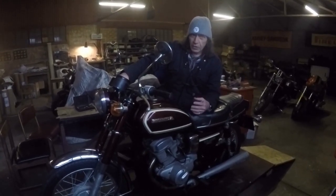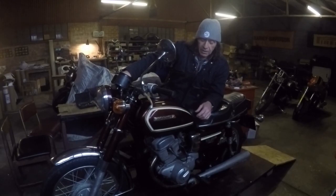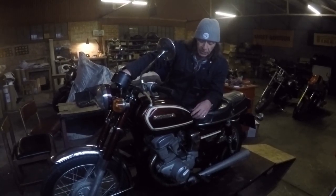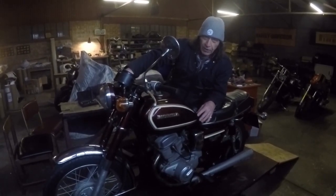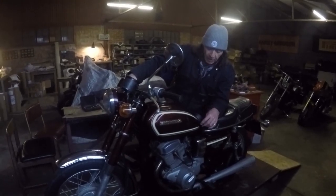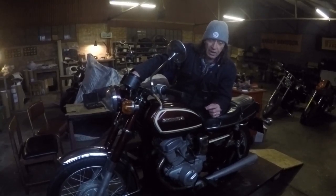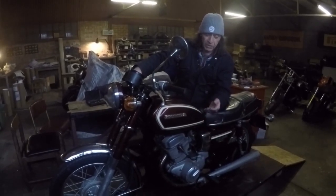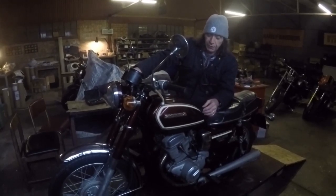Since then I've done a few more bits to it and I'll just give you a rundown of what I've actually done. I fitted a new condenser and we did the advance and retard mechanism - you've seen that already. A new condenser went on. I put a new spark plug cap on - I think the one on there was a bit dicky. We've got two newer plugs and I've actually got a half decent spark, not quite as good as I want but I think it's there or thereabouts. I also took the carb off again, ultrasonically cleaned it again, but the main reason I did that is because the float needle arrived - the needle that shuts off the fuel when the fuel goes in the carb from the fuel tap. The level comes up in the float bowl and the float floats on it and shuts that off so it's the right height. So I put a new float needle in.